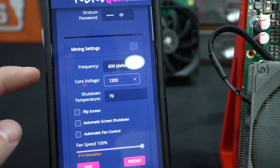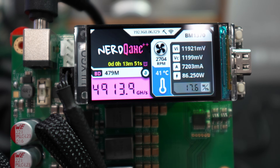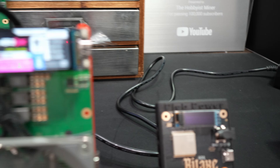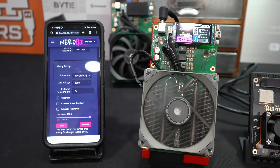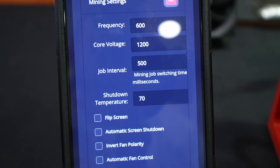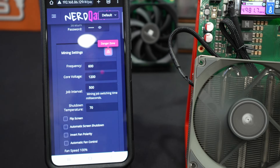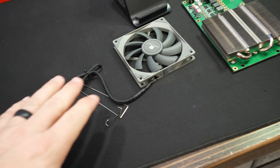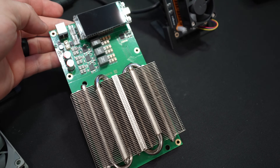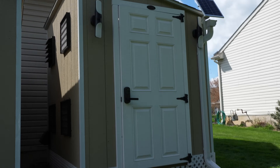We've been up and running for almost 15 minutes and we're not really seeing a lot out of the hash rate — 4.9 terahash — and our watts have increased by about 10 to 97. There's a little button in the upper right-hand corner they call the danger zone, which lets you configure things manually. So we're going to have some fun with this. I've gone ahead and removed the bracket and the fan, and this is what you're left with. Let's take this out to my shed.